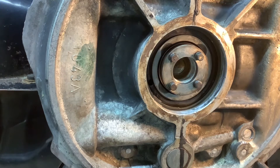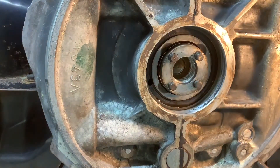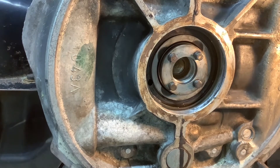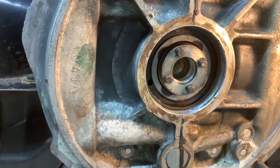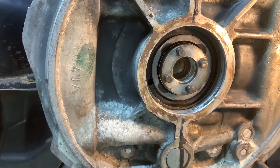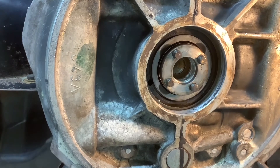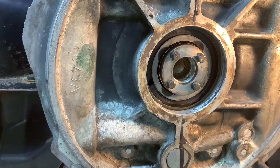Let's take a close look at what's going on with the main bearing in here — it doesn't look good. Watch the bearing... it's spinning. It should not be moving; it's also moving in and out. Now, this thing was driving around a few weeks ago and really didn't sound bad, but that's not good. I have some decisions to make.